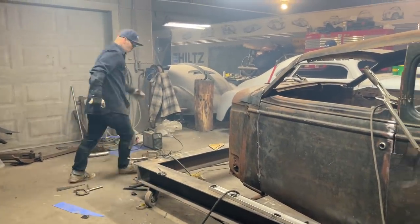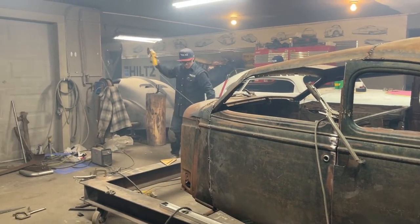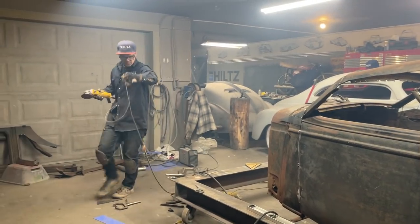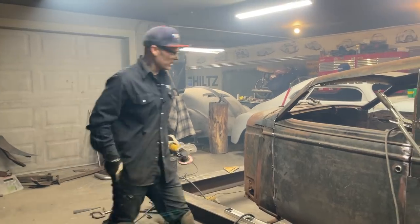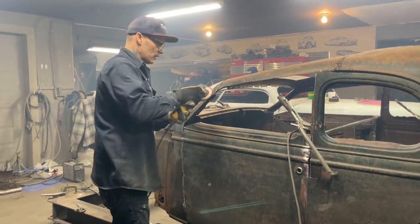I think I should clean it up a little bit more just because I want it to penetrate and I don't want to keep building weld up there. I got to have quite a bit of weld build up there. And any place that's low, I jam the weld right to it with the coat hanger. Why not? I can grind it off.